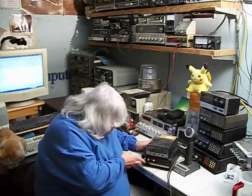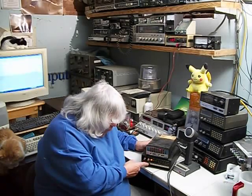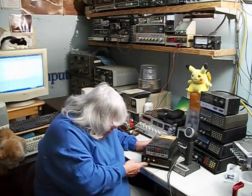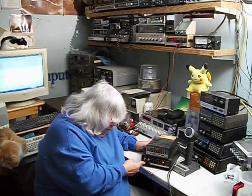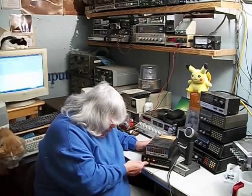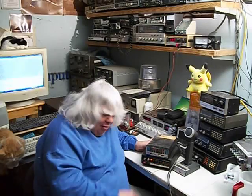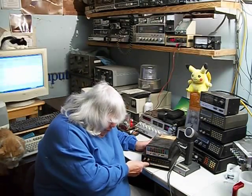I found out why just now — it's this switch. In a certain setting you push the switch and it works; if you touch the switch again it might not work. That switch right there is the culprit. Now I know what's wrong with it — a little contact spray to that switch right there will fix it.